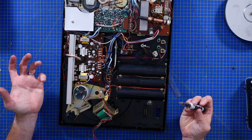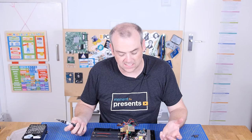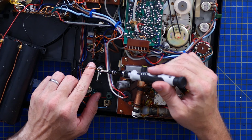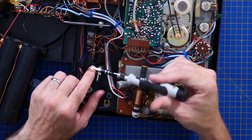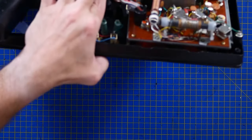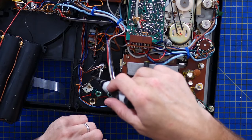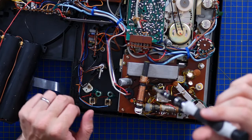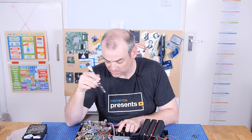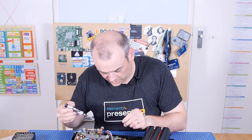This bit here is the bottom of the tone arm — the bit that swings out and has the needle in it for the records. And it only has two cores; it doesn't even have anything attached to the metal post. And that tells me the record player is only mono. So although it's got 'stereo' plastered all over this, it will only play records in mono. Don't be fooled, people.